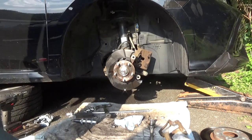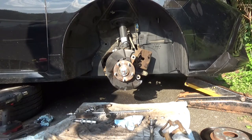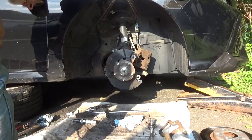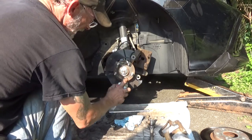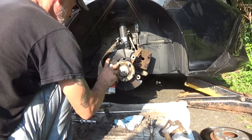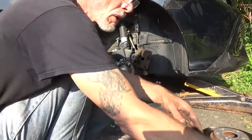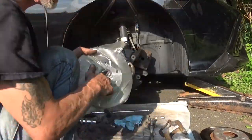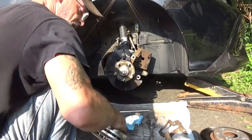Spray it down with the brake cleaner, make sure you've got all the debris off of it. Grab another can of brake cleaner — all done and dry. Put a little bit of fluid film on it, just like you're doing a light coat of spray paint, going over the rusted areas. Take your new rotor out of the bag. In this case, we've got rotors that are coated with a machining oil — you're going to need to get that machining oil off of them.